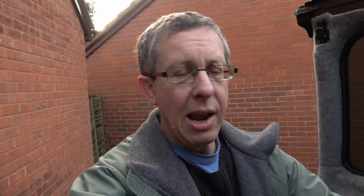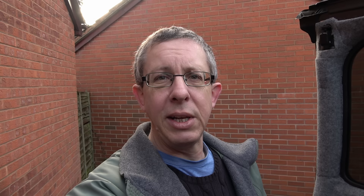There is one more thing still to do on the fuel system. Autoterm Planar do say in their instructions it would be a good idea to have a fuel filter between the fuel tank and the pump, but they don't supply you with one. You have to go to eBay or Amazon and buy some random cheap filter for about £10. Since Autoterm recommend having one, why don't they include one in the kit — or at least the little joining clips and plastic bits you need to fit it? It doesn't make any sense. So all I need to do is cut the hose, put the filter in, and then I think I'm ready to do a test start-up of the diesel heater.